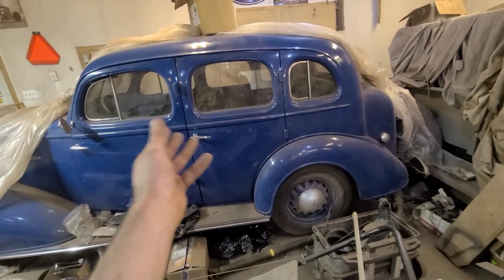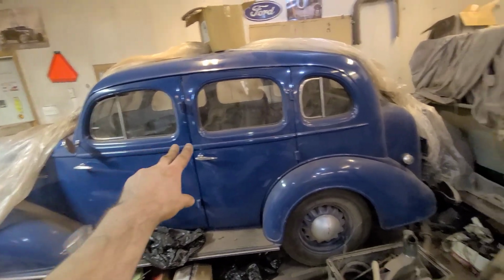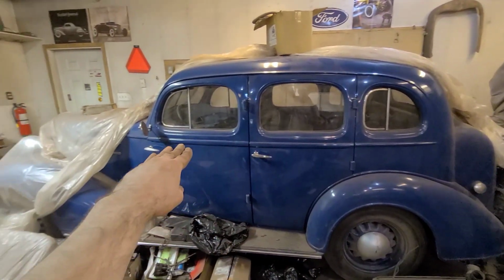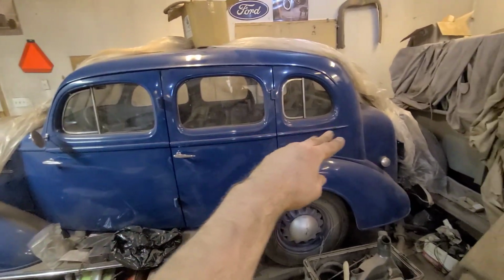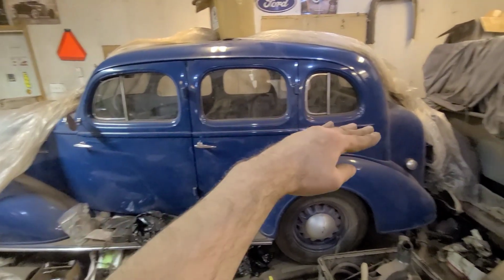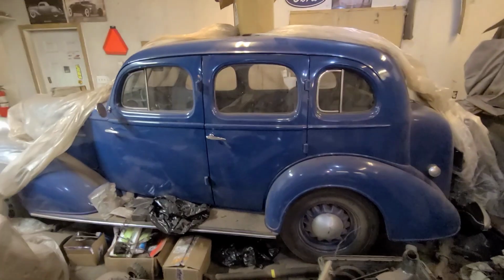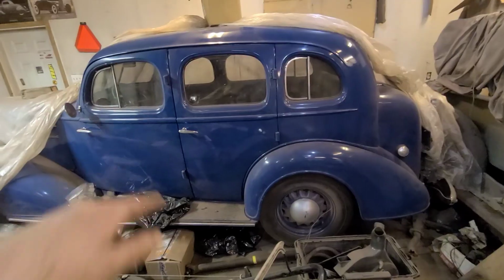First thing is obviously whether or not it's rubbing anywhere, but kind of the most important thing, just for appearance sake, is making sure that the car is actually tangent. So that's where we make sure that all of our body lines and everything are kind of in one straight line. And that's kind of the hardest thing to do because, well, you can see this car, it's all over the place. So trying to get all that lined up and right, and things where the door isn't rubbing, and so it all looks like in one straight line, that it does make a big difference to the final appearance of a car, more so than the gaps or anything else. Obviously gaps are important too, but that's another problem for another day.